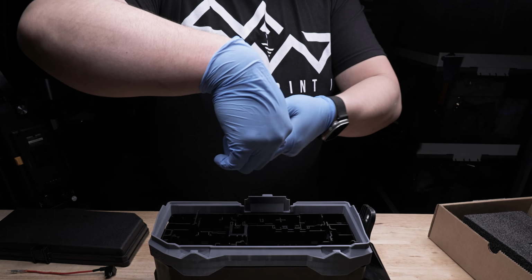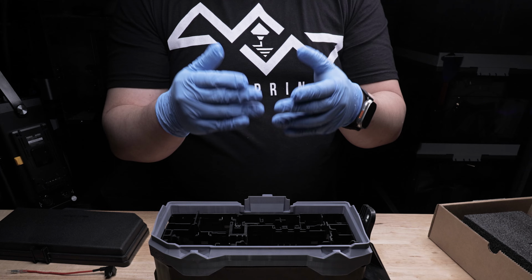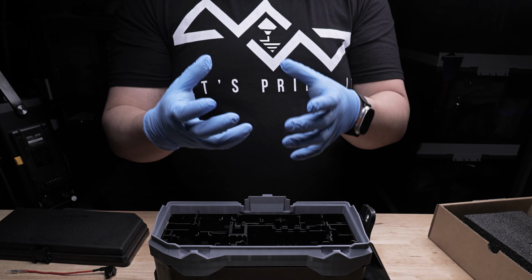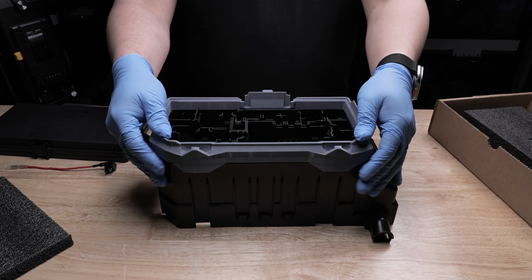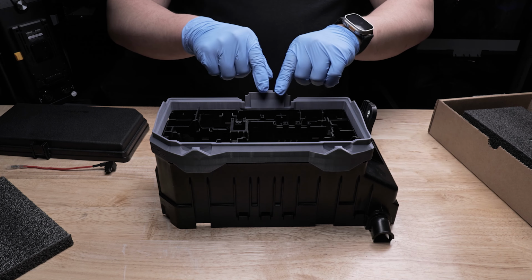When I say peel upwards, I mean out and up. You don't need to go very far outward. You only need about 2 to 3 millimeters because it's holding on just barely, but it's a lot of material, so you'll meet a lot of resistance. Now that these back portions are loose, don't just try to yank it off. You'll actually break the riser by doing that. Go ahead and move over to the front here.